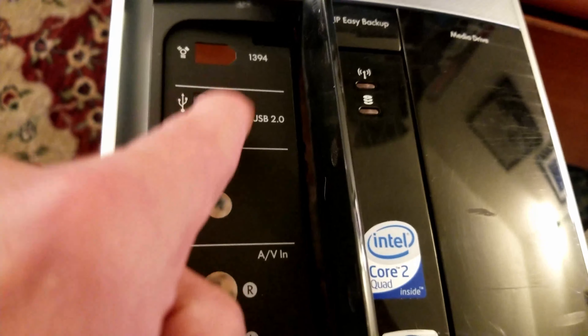This BIOS is pretty basic. We've got our four gigs of RAM actually running at PC2-6400 speed, which is 800 megahertz. We have three drives detected: the 320-gig hard drive, the DVD drive, and the HD DVD drive. The clock battery was dead — I put in a fresh one. We have our Core 2 Quad Q9400. I'm going to change the primary video adapter back to PCI Express. It defaults to RAID mode, which is interesting — I would have expected AHCI. The features available in this BIOS are XD bit, virtualization technology, and restore on power failure, plus a very basic boot field. There's not a lot of features in this BIOS, but we have the system up and running.